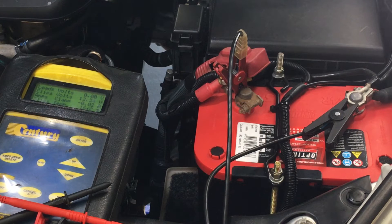What voltage should we see? The voltage we should see once the engine is started should be either side of 14 volts - that's a good charge rate. Every vehicle varies. It can be as low as 13.5. Smart alternators have variable voltage, so it could be anything from 13.3, 13.5, 13.8 - basically that is charging. I'd like to see around 13.8 to 14.2. This vehicle has an alternator voltage booster diode installed, so it will charge at about 0.5 to 0.6 volts higher than without it. So it might start up at 14.5 and end up down around 14.